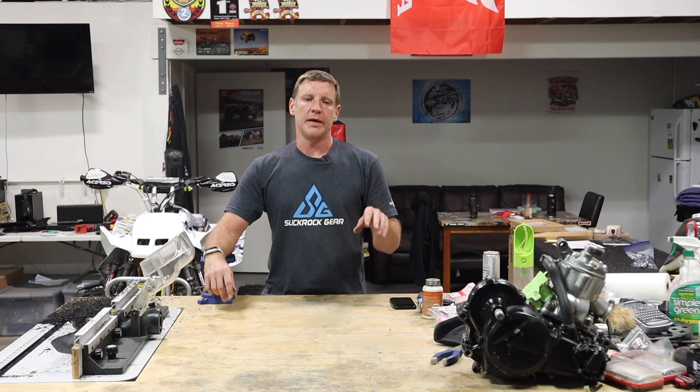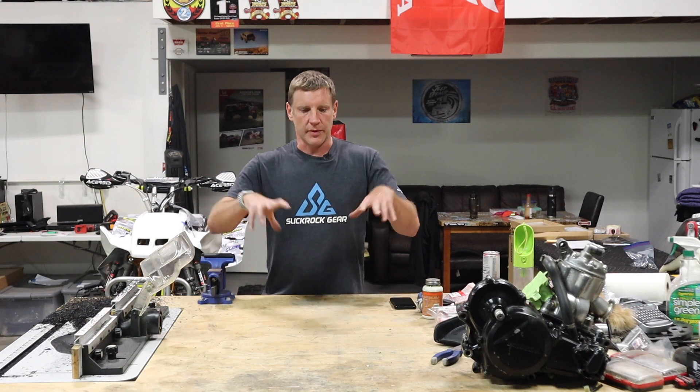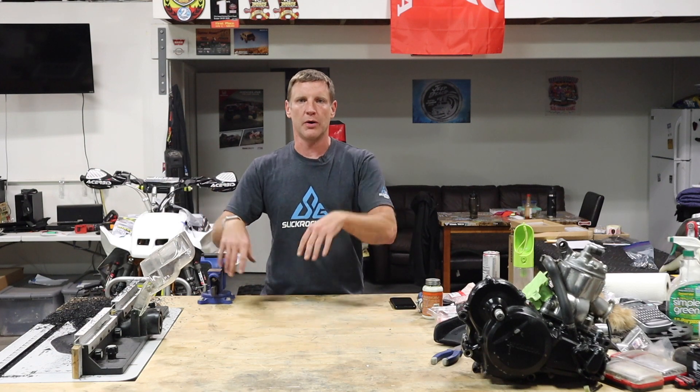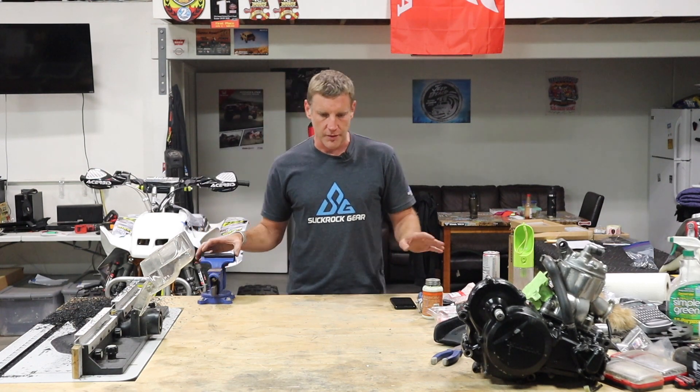I'll get into the motor on the next video, then we'll go into battery, controller, and all that stuff. I have the motor here and it's going to be a great fit. I need to mock up and fab up some mounts — I think I'm going to do it in billet. My goal is to try to do a bolt-on system, because the Apex and the DRR mini quads are very similar. The main difference is the Apex is a little bit longer — the wheelbase is longer — so you actually have more room in there for the battery. If I make a base plate, it can be moved over to the DRR or used on the Apex. You can preserve the original geometry without welding, and if you ever wanted to convert it back to gas, you could.